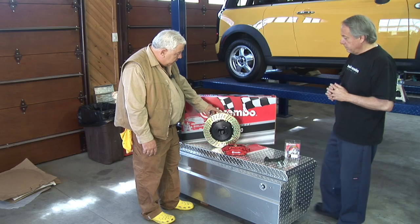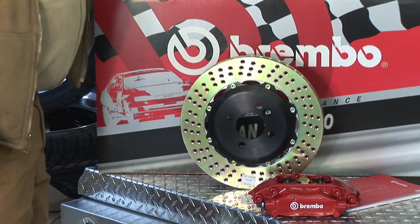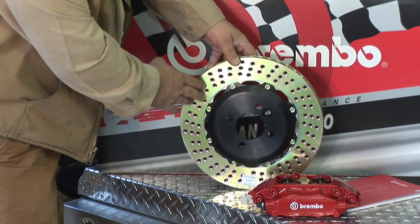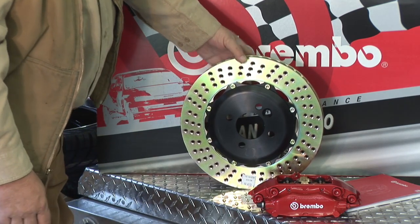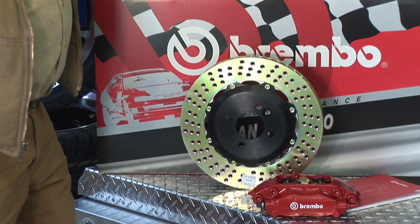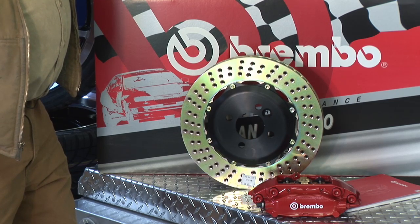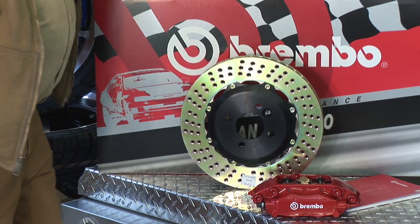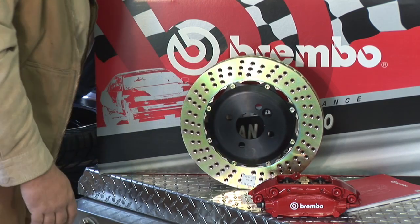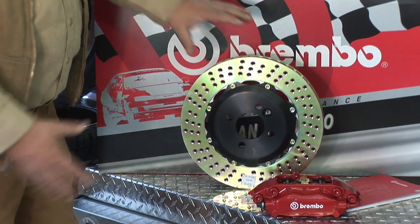This also looks a little different. Let's get a close-up and talk about the rotor itself. I'm used to seeing the rotor with the braking surface and then the center looking like a pillbox or a hat. We've got a piece of black billet aluminum here. Well, this is what they call a floating rotor. Most rotors are made in one piece and are more rigid. This actually allows the rotor to float a little bit — it's a two-piece system that allows movement radially and axially. That should lighten the rotor quite a bit and allow us to dissipate more heat without warping the whole unit.